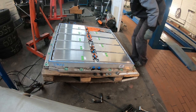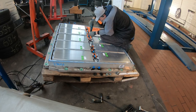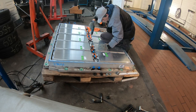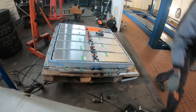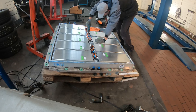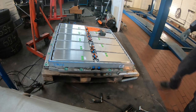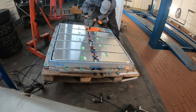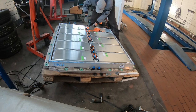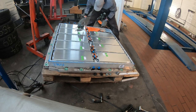What a short circuit will do is vaporize your tool, generating very hot plasma that can burn body parts. That's why you should use isolated tools and also wear protective fireproof clothing. In the case of this VW battery pack, they've diminished the likelihood of that happening by design — there are basically no exposed metal parts under voltage. The bus bars are isolated and the bolts holding them are enclosed in plastic, so even dropping something in there it's nearly impossible to short out anything. Even shorting just one battery module could cause thermal runaway, where the lithium cells catch fire — super hard to extinguish.